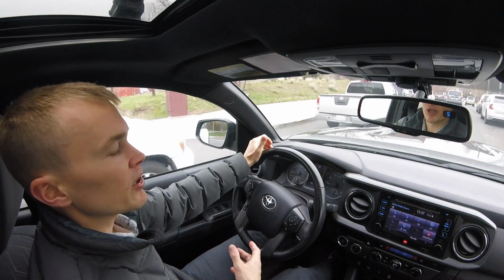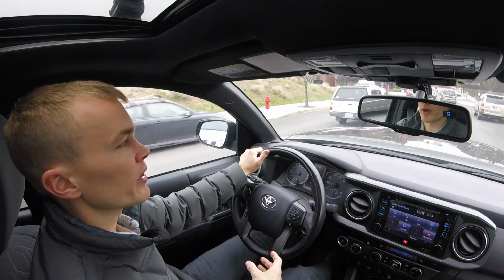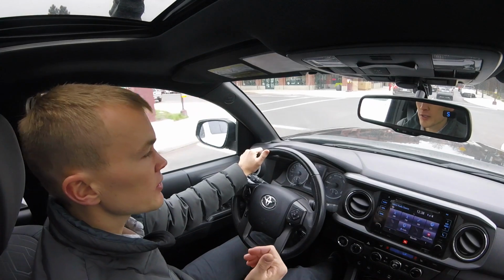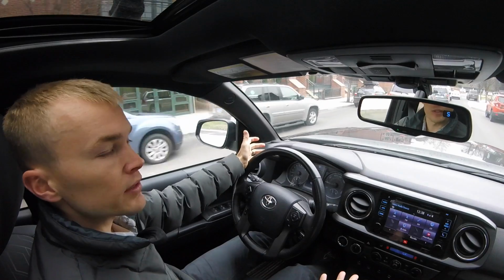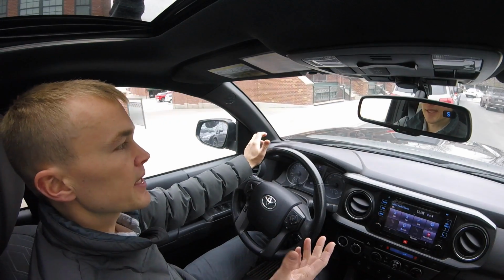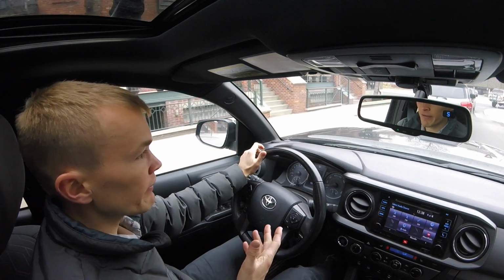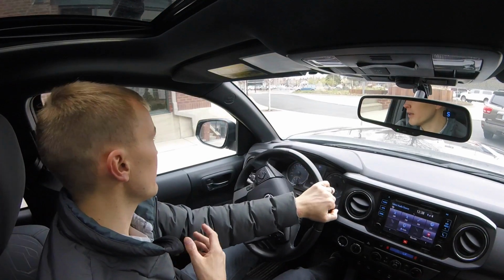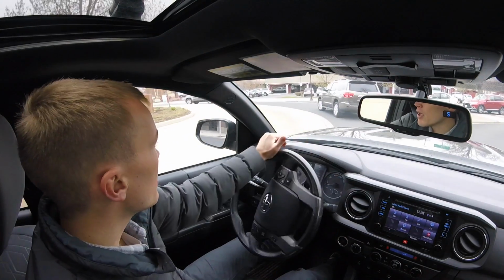That can change a little bit when you go with a Bilstein setup where you're reusing the factory coils. That can stiffen the ride. Adding an add-a-leaf in the rear can also stiffen the ride. And so I really liked that idea with the lift leveling kit that I went with, is that you're basically maintaining the factory ride quality. And having driven it for a short time now, that's what I've seen, is that the factory ride quality is pretty much there in all areas except for one.